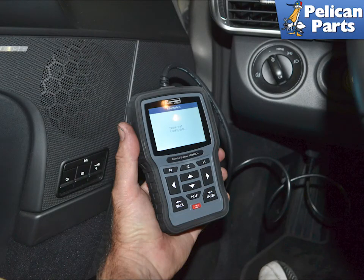If you have replaced the ABS pump, introduced air into the pump, or cannot get a firm brake feel, you must use your scan tool to set the ABS pump into bleed mode. Leave the power bleeder attached and pressurized. Attach your scan tool, go into the brake menu, and set it for ABS bleed mode. Bleed the calipers in the sequence the scan tool instructs — it should be rear left, front left, front right, rear right. Throughout the entire bleeding process, the brake pedal must be held depressed for 2 or 3 seconds, then released slowly. After operating the pedal for the last time, hold the brake pedal down and close the bleeder valve.